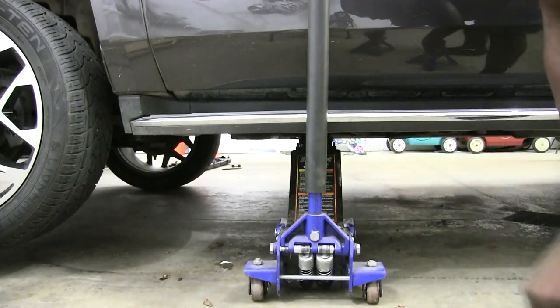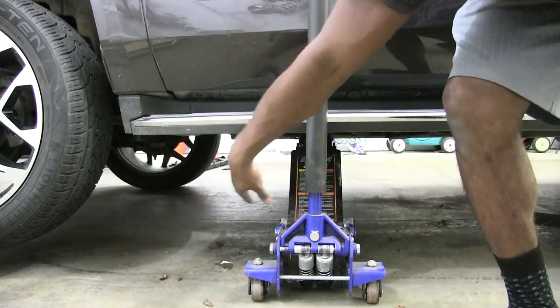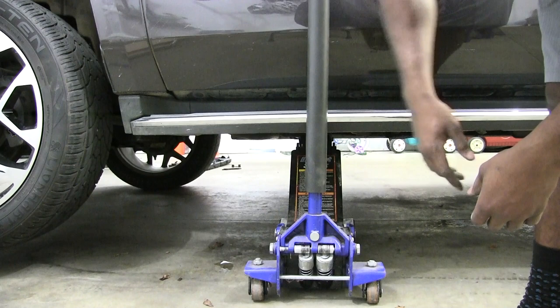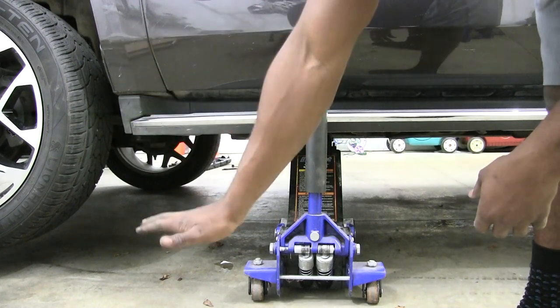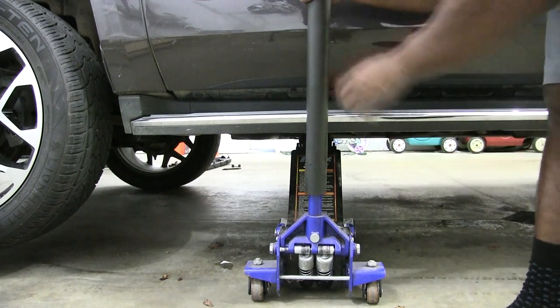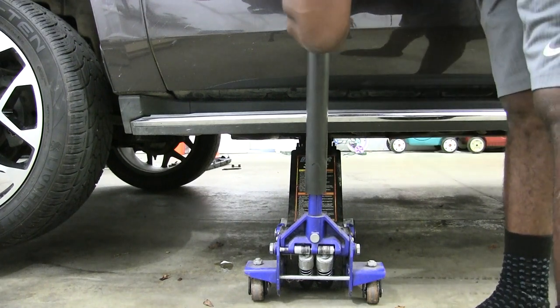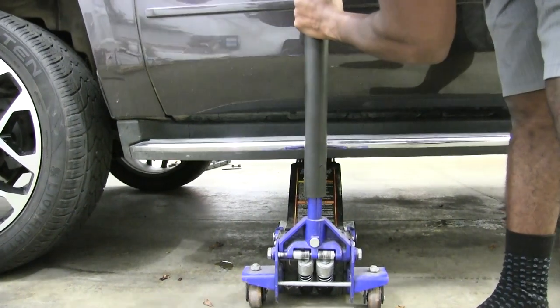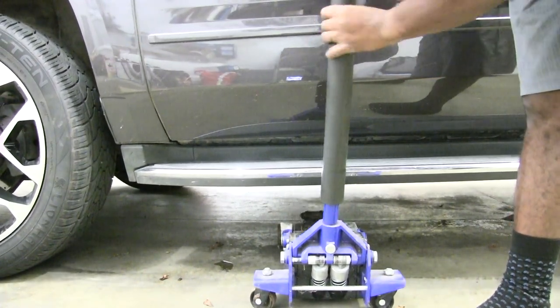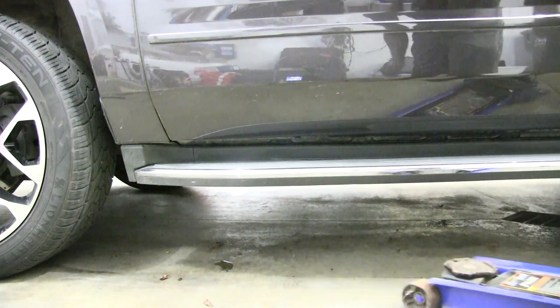Under there, make sure that there's nothing underneath your car. Make sure there's no bolts or screws or anything sitting underneath your tire. Last thing you want to do is put your vehicle back down onto a screw. When the vehicle weighs that much, it's definitely gonna mess up your tire. So everything's clear, I loosen it down, boom, I just slowly release that, pull that out from under there,